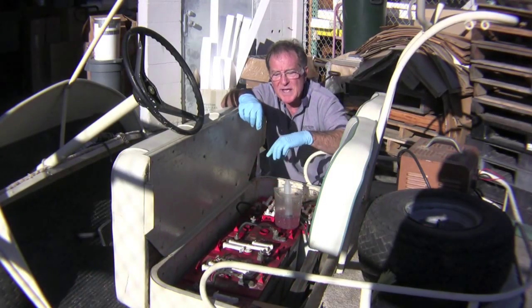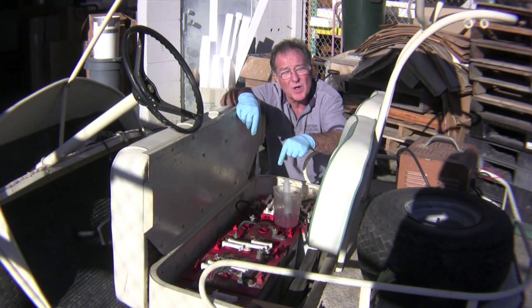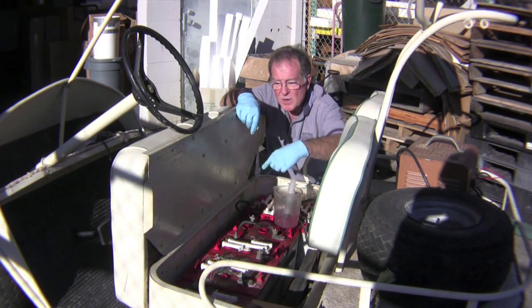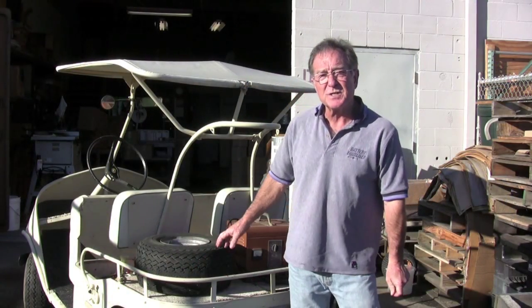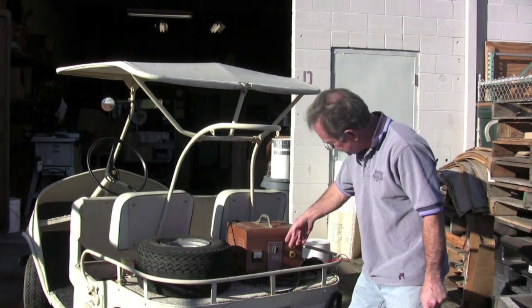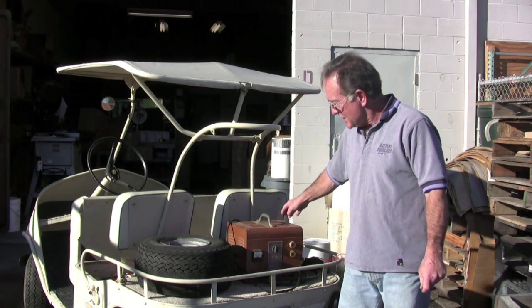Now that we've determined that all of these batteries have the proper voltage, and there's no dead cell because all the specific gravity is up, we're going to treat all of these batteries with 2 ounces per cell, and then we're going to have to do the charge and discharge cycles. You have to exercise these batteries, charge them and discharge them. Use the standard charger, antique as it is for this model here, but this is still the battery charger that was recommended. Use this.